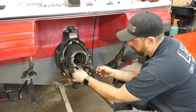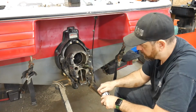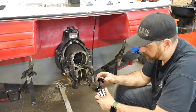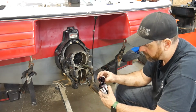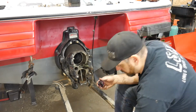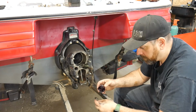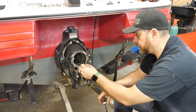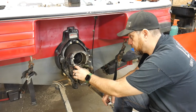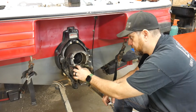But I happen to have gasket glue, so I'm going to put a little bit of gasket glue on there. Some guys will put the bellows adhesive on there, just a tiny little dab, and you don't need much. Don't go crazy. Just put a tiny little dab of whatever you've got. Like I said, grease will work. But I just do a dab at the top, dab at the bottom, and then stick that on my hull and just let that seal up for a minute before I go ahead and do anything.